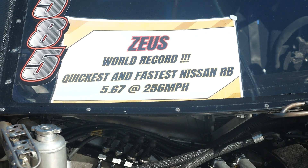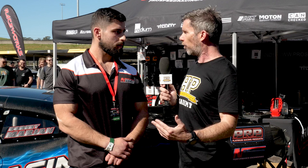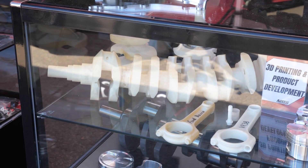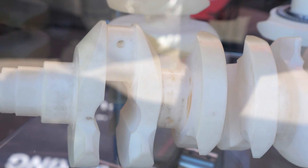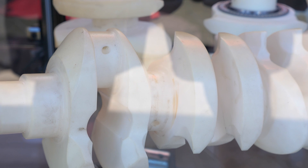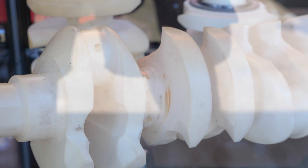The development process for including this roller thrust was actually pretty straightforward. Starting from the existing crankshaft design, they added some extra material to the front counterweight. They then 3D printed just the front counterweight and first rod bearing section, fitted it into a block to validate the design, and from there it was ready to go to manufacture.